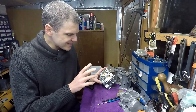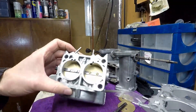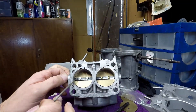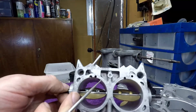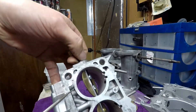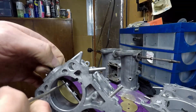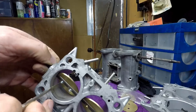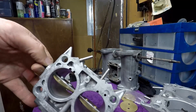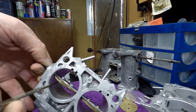I need to come in closer because it'll be difficult to see. On this side you've got the standard shaft with the standard throttle screws. As you can see, you've got two problems — when the throttle shaft opens you have this screw presenting quite a restriction to airflow, and there's quite a lot of it coming down on the other side. So at wide open throttle you've got restrictions on both sides.